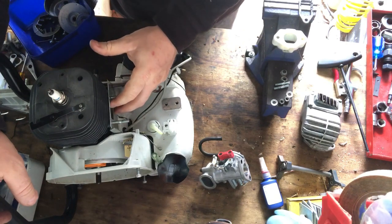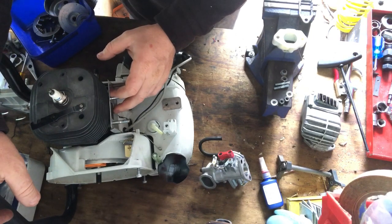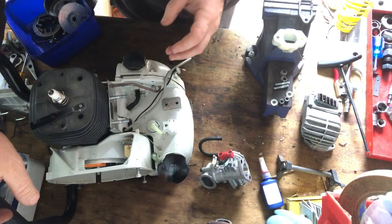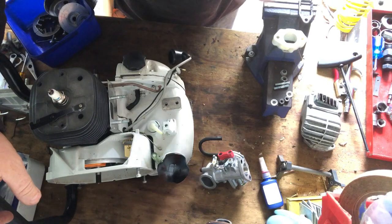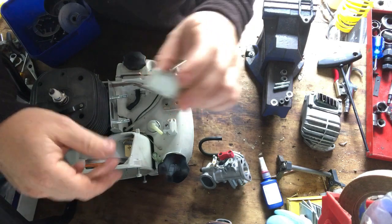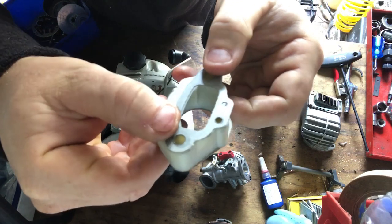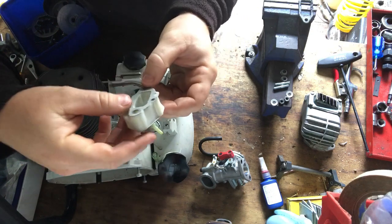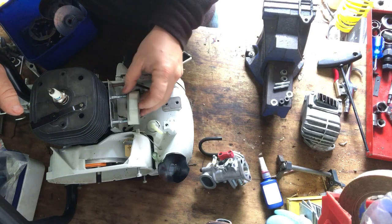So you've got this gasket going on here. There's a gasket behind there, and a heat shield as well too, just a paper gasket. And then you've got the heat shield from this that shields the heat from this part of the engine. And then basically this goes on, and you just make sure, again, as you can see, it's got a hole, which is this one, the impulse line, and that just goes on this side here with the impulse line going through it, the impulse hole line.